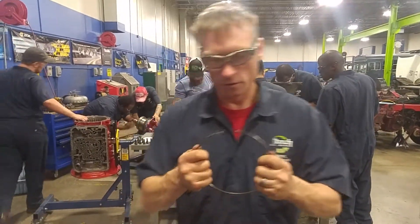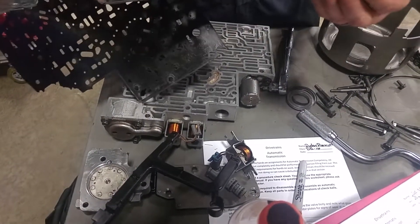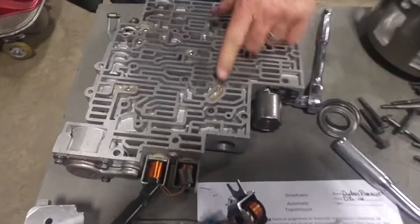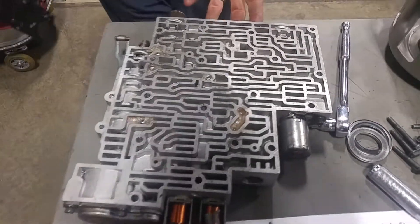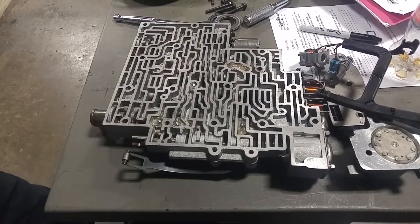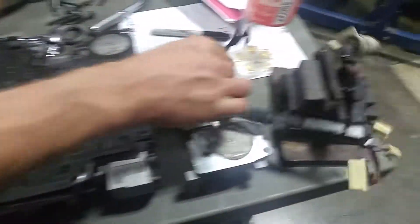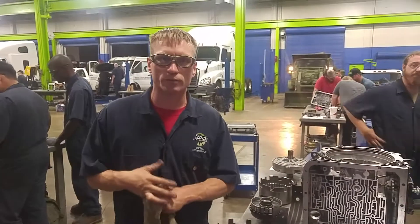These snap rings — you don't want to over-flatten them or put them in too tight. Over here is your valve body. Here's your gasket, plate, and the other gasket. That's your little key for holding your brake band still. This one here is missing a couple of the ball bearings in there. This is where all your fluid will sit, and the valves right in here are controlled electrically and hydraulically by different forces — they change the hydraulic flow through the transmission. This thing has a various number of different sensors to it, and an electrical harness that we'll put back together in a little while.